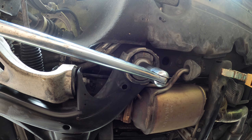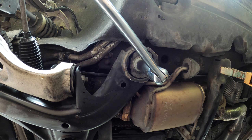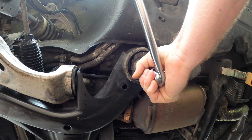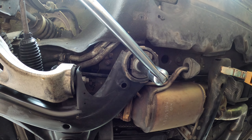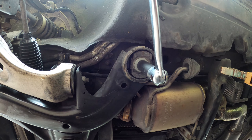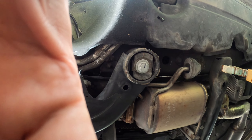I dislike yield bolts. You can feel it - it's just a tiny bit away. You can feel the bolt start to stretch. There we go, 180 degrees. It's an interesting feeling if you haven't done it before - you turn the bolt and it starts to get a tiny, tiny bit easier. It seems counterintuitive but it works.